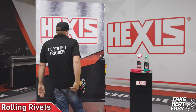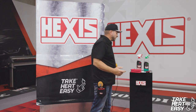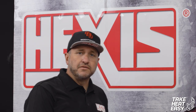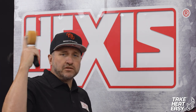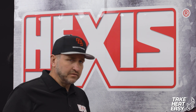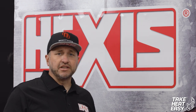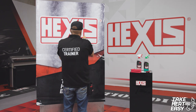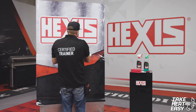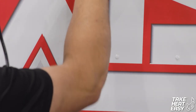For the next step on the top part of this panel, because of the low-tack of the adhesive, you can choose to do the entire panel before this — heat it and roll the rivets. I'll grab a rivet roller; any kind of foam roller works just fine, and a heat source. You can use a torch or a heat gun. The whole name of the game is heat and roll as you go along. The heat will activate the film and the adhesive, and it'll conform tight around each rivet using the roller.